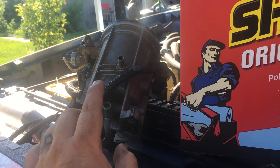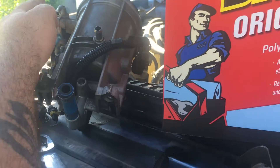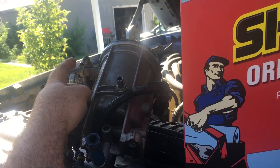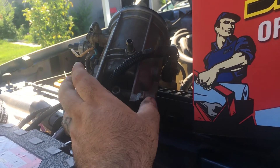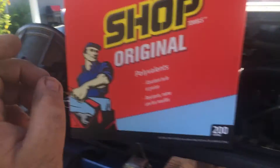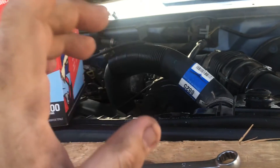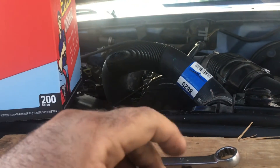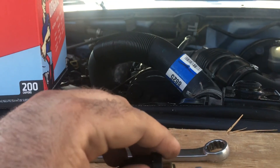I leave one hose on and take the other hose off — works pretty well. There's a fuel line you have to take off as well to get the bowl out, and one electrical connector. I'll try to video some of it, but I'm going to go ahead and connect it all up first, then put everything back together and fire it up. Hopefully this solves my problem — if not, it's going to be my ICP sensor.